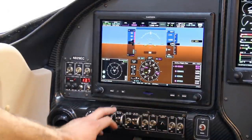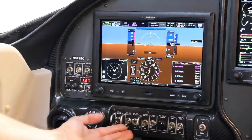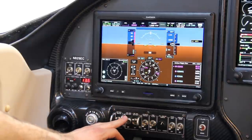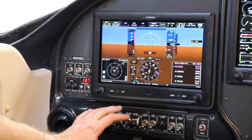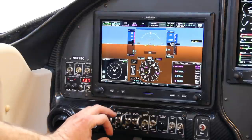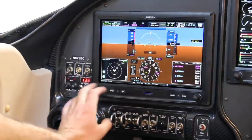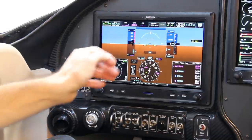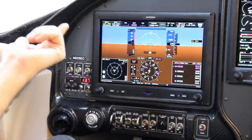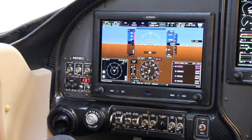Then my main power switch — I've got my battery master, which turns on the VPX and all other things running directly off the main bus. I've got an avionics auxiliary battery — a second TCW IBBS — that powers just the bare-bones absolute critical flight systems. With that switch off and everything disconnected, I would still have my MFD running, my ADAHRs — my gyros and air data — my engine analyzer, and my autopilot control panel.